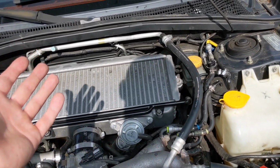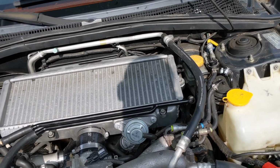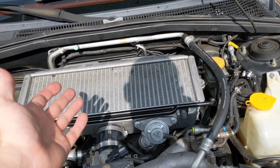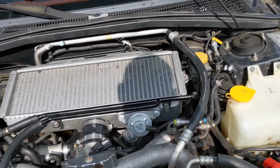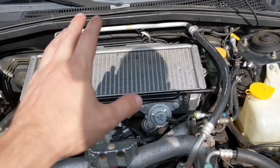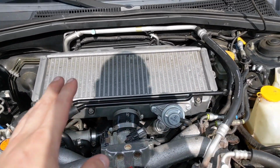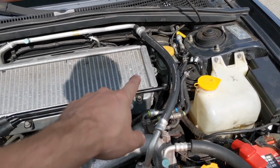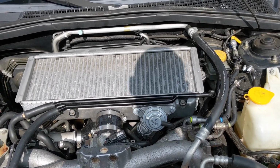And the big thing is it takes a long time. You got to fill it up, you got to drive it around, you got to drain it, you got to fill it up, you got to drive it around, especially for me because I had to take this out each and every time. But I did that about 2 times. And now that I'm done, I haven't showed it yet because I put everything back together. But you have to make sure before you drive off, you have to make sure your fluid levels are correct. Not just from the dipstick, but get into the vehicle, turn it on, and go through the gears. And that's what I'm going to show you right now.